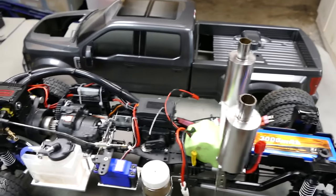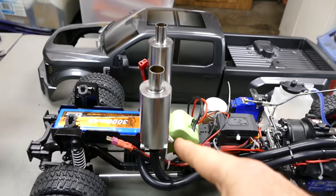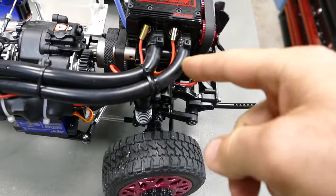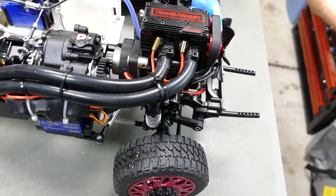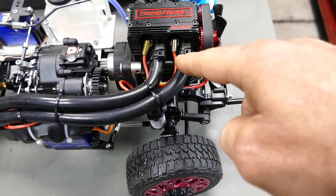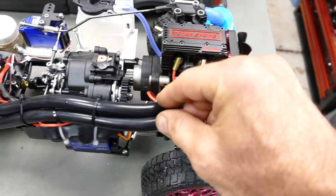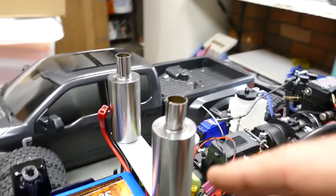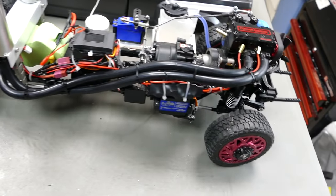Now, like I said, on this side, I'll flip it around, stacker exhaust. This is silicone tubing, high temp, so I thought, you know, I'll give it a try. It should work pretty well. They can take a lot of heat. It just comes off the manifold here, straight down, trying to make it as neat as possible, straight back around, and just up underneath these two silencers. Now, these parts, along with everything here, I'll leave links in the description if you want to go check it out.